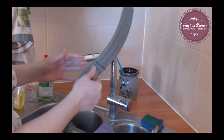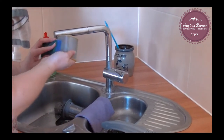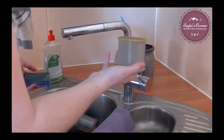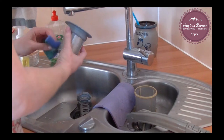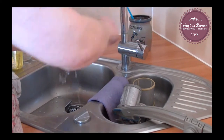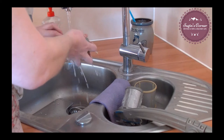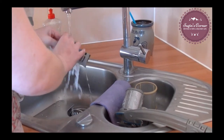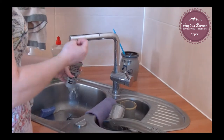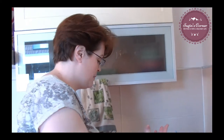If we're cleaning here, we're going to take a little bit of detergent and gently clean it. Even if you clean off your plates thoroughly, still clean this — check it about once a month. You can see even here some of the things stuck on here are actually calcium deposits. You will notice a big difference when you put salt in your dishwasher. When you don't have salt and you open your dishwasher, it's just a little steam. When you put salt in your dishwasher and you open it, it's like whoosh — a facial! Because there's going to be so much more steam.